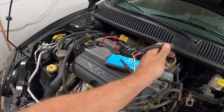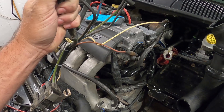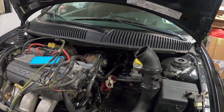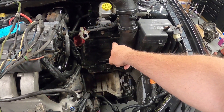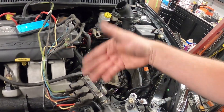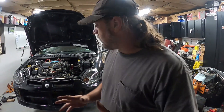You will need this line if you're keeping the EVAP system running. The EVAP line runs here — there's a purge valve in the back with a line that tees off and runs down to a solenoid. Basically it puts vacuum onto the fuel tank and pulls fuel vapor back through, pushing it into the intake. That's your EVAP control system.